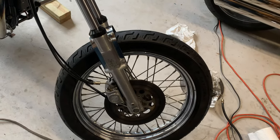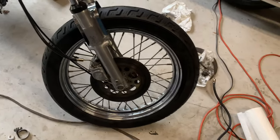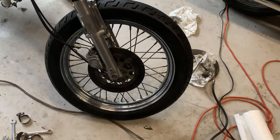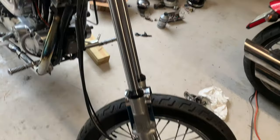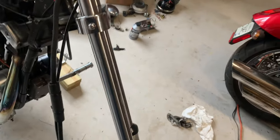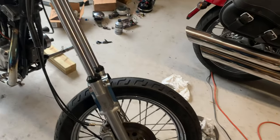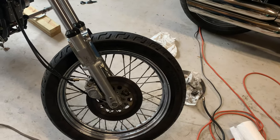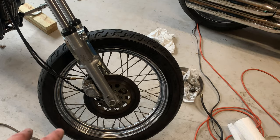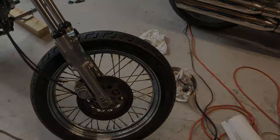So, the right side, or I guess left side, brake ended up locking up on me, and the front end went sliding there in the last part of the video. And so now we just got rid of that and went straight to one line down, got a coupling in here, and then on down. It actually worked just like that instead of going to split. So this should work, and one brake is plenty. A lot of people didn't run brakes on choppers because it's a little bit scary because that front end doesn't have any weight on it, so it just kind of slides around.